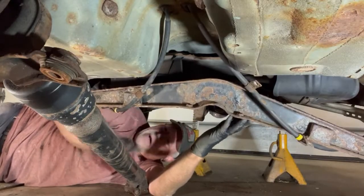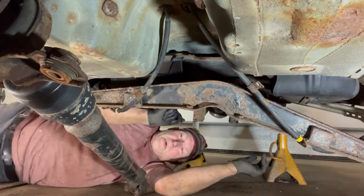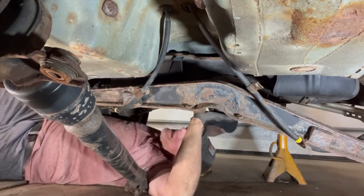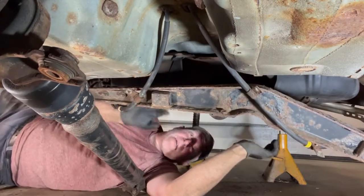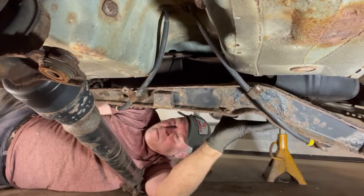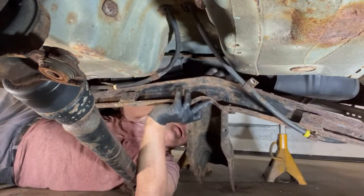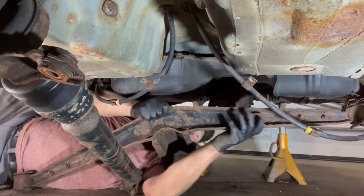Everything's out, unbolted, and falling down on top of the emergency brake cables — also caught up on the diff. To get it past the diff and past the emergency brake cables, the outside of this housing you're going to have to lift up as high as you can, and with your opposite hand pull down on the diff and slide it over. It's not the funnest thing in the world, but once you get it slid past the diff, just be a bit careful with the emergency brake cables so you don't mess those up, and you should just be able to slide it around and out it comes.